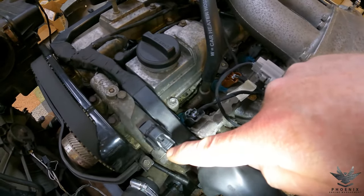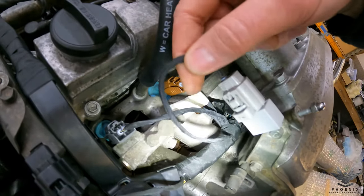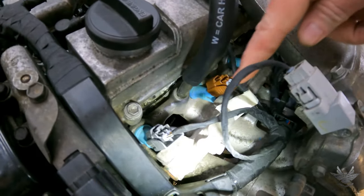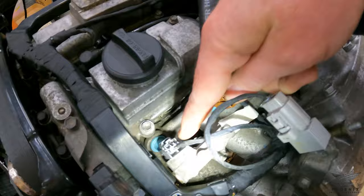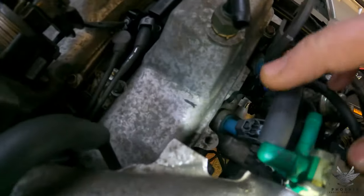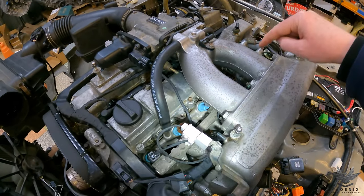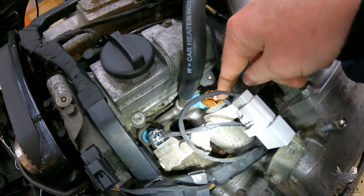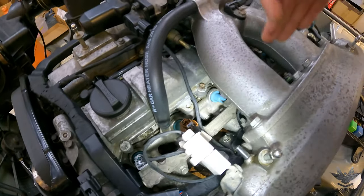The first thing that breaks out here is your oil control valve. Coming a little bit further along, just before the plastic section, you break out for your noise filter — you should have this little bracket on your engine with the noise filter there. Also coming out there, starting with the injectors: injector one and injector two. The colors are different to differentiate them — you've got gray and brown alternating. If you put the longer one here, the shorter one won't reach over there, so the length also helps a lot. Start with your first set of colors and continue from there.